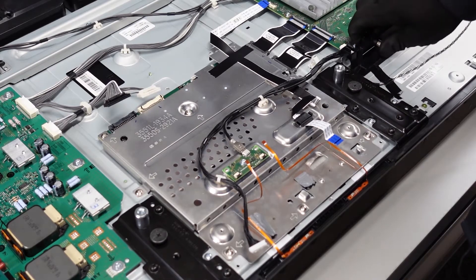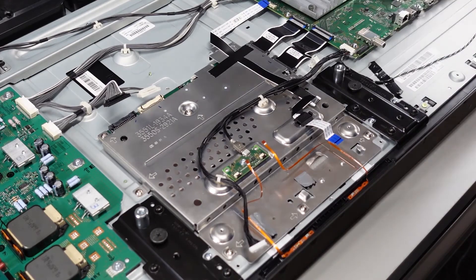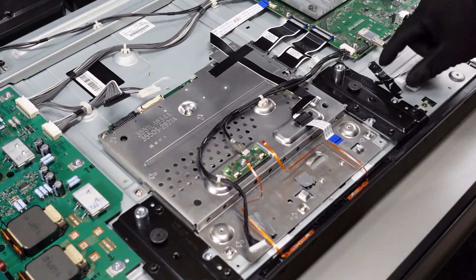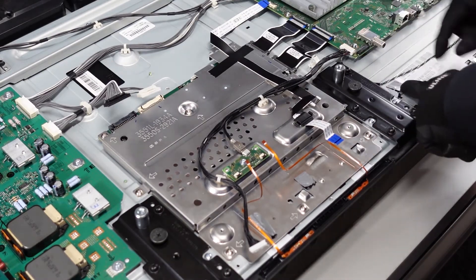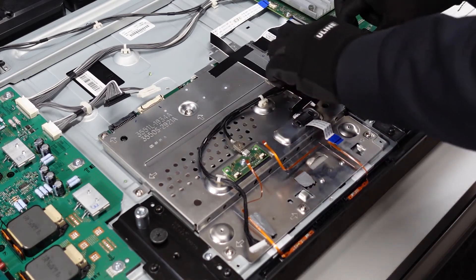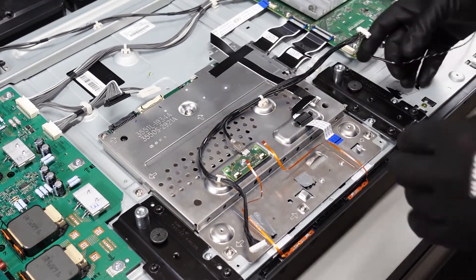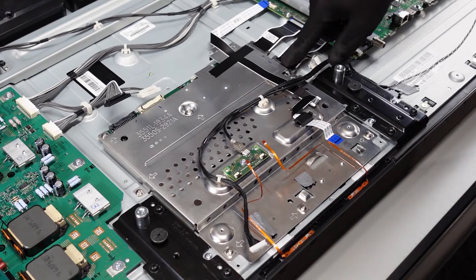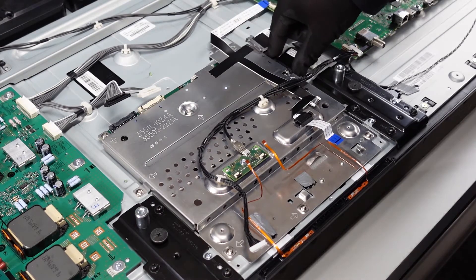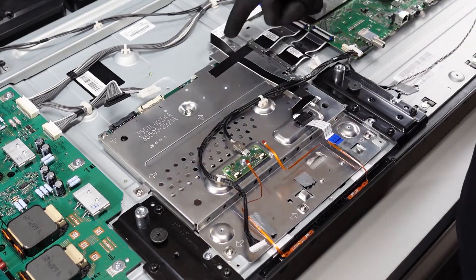Now we've got to get this bracket removed first. Very gently, press your thumb on the coax and get your fingers underneath this plastic piece — this whole thing should come free with just a little bit of elbow grease. Sit that off to the side. You'll notice another strip of tape connecting to this cable — peel it back very gently and get it out of the way. Now, pinch the cable on the sides and slide it out; you might need to use both hands. Rock it a bit — she's free. Be very gentle and sit that off to the side. Now we have two LVDS cables: pinch them on the sides and pull right out. Walk it out of there. Get that one free, then work on the other one — pinch it on the sides and shimmy it out.